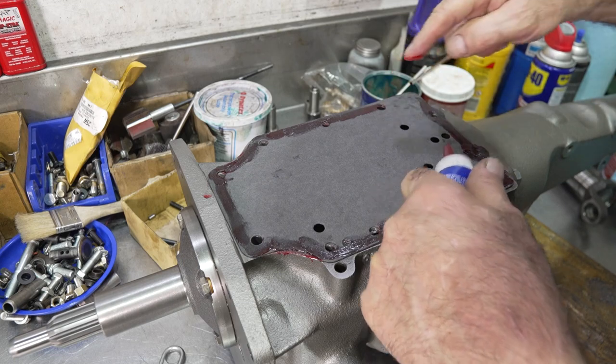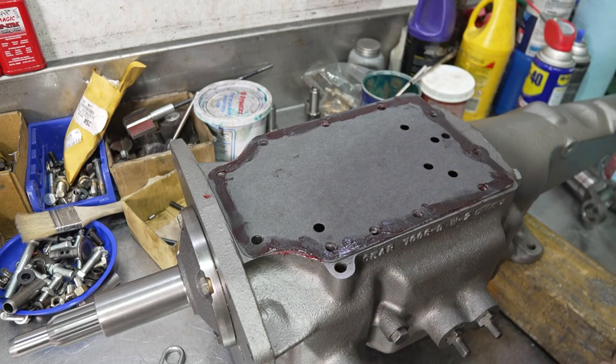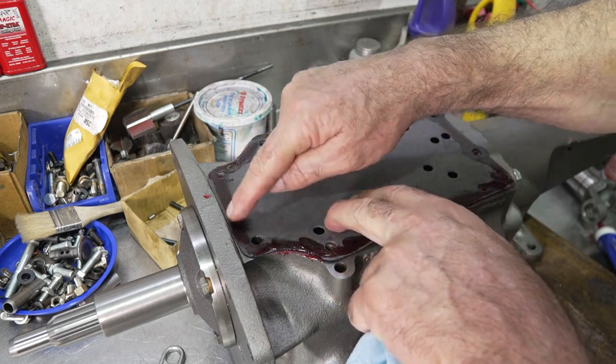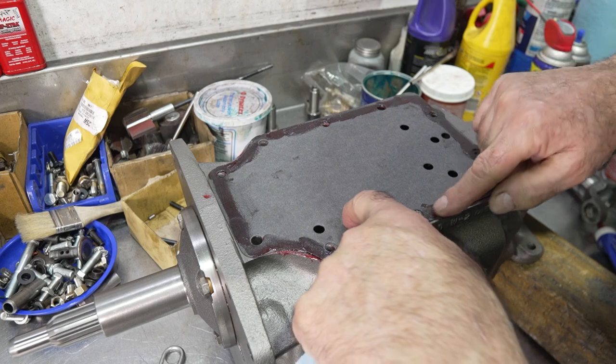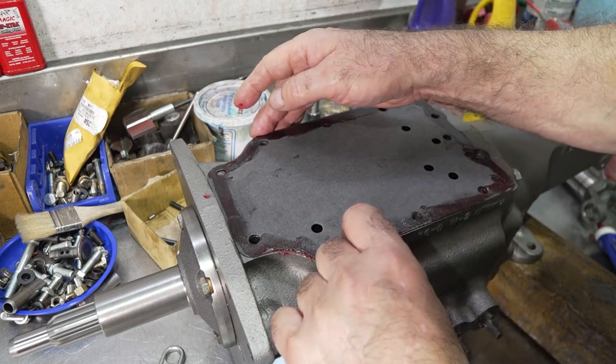The downside of top loaders is the gears are really big and very heavy, right? And sometimes they're not going to really shift that good above 7,000 RPM at all, because the inertia of the gears is just too much.